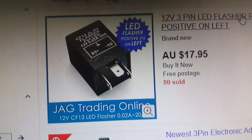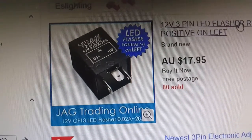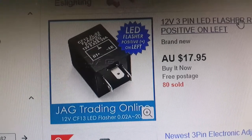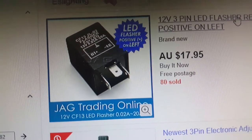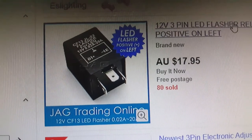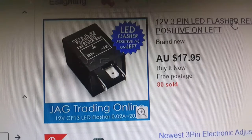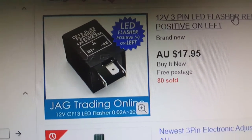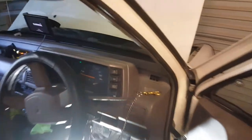So there's less load on your generator. That's the LED blinker indicator flasher — you'll have to change out your bulb-type relay for this LED one. Although you'll still have bulbs in the front indicators, I'm not really sure how that works exactly, but you have to exchange out your indicator relay before installing these LED lights.